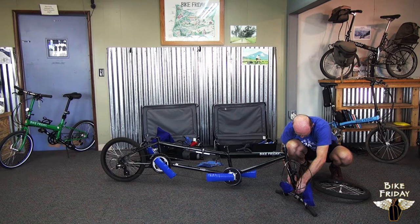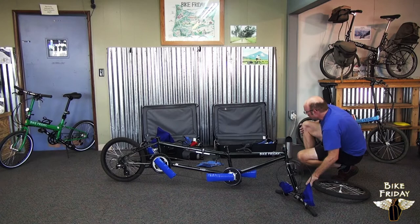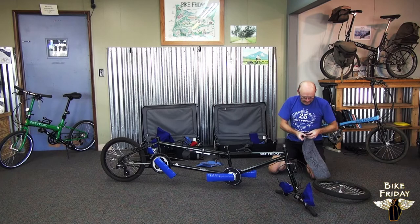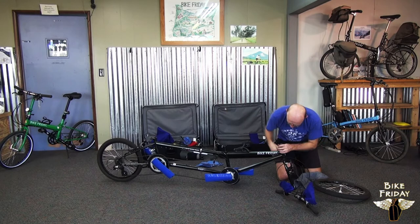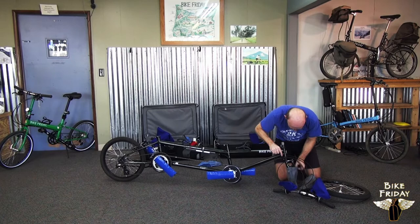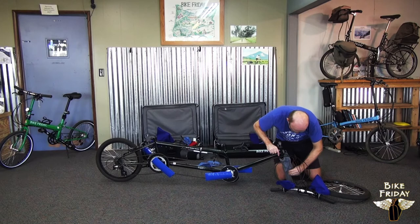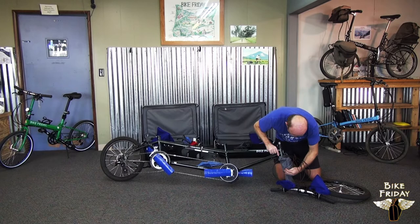At this point I like to put the brakes back together just to keep some tension on the cable — it just packs easier. And there's a gray felt bag for the front fork to keep it looking nice. You just have to work it up over the brake arms — it's a bit longer than it needs to be, but that doesn't hurt.